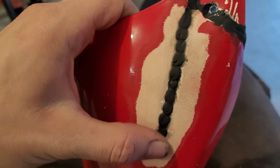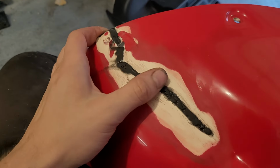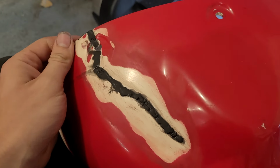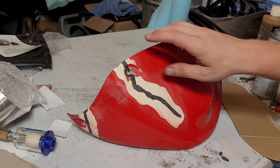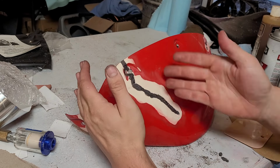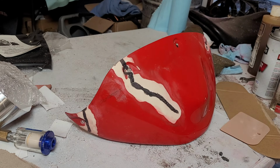This one's perfect. I don't even need to knock it down. We'll just hit it with epoxy that I'll sand a little bit. So yeah, I'm just gonna hit these with the DA, knock down the Plastifix, and rough up the paint around all of these, and then we'll hit it with some two-part epoxy. Got everything knocked down to where basically it all just needs to be brought up. There's like a divot, which is what we want, because now it's time for our filler.